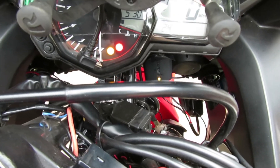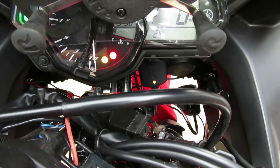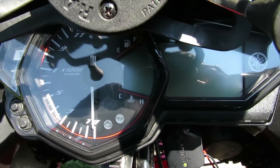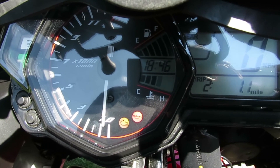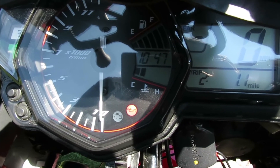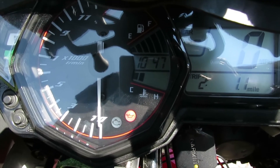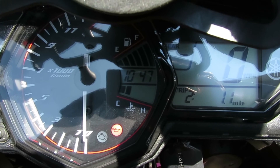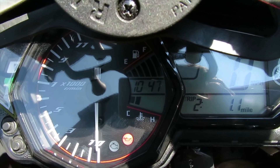It looks like I may have to ride the bike around a little bit to see if the code just needs to circulate through the system. After riding the bike around, when I turn on the key the check engine light actually just went off. That means it was a faulty O2 sensor. I only did 1.1 miles — pretty much just went to the gas station and back. So there you guys have it — that's how you clear out code 24. Code 24 just means it's an O2 sensor. If you found this video helpful please hit that like button, leave any questions in the comments below, and subscribe for my latest videos.